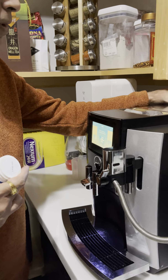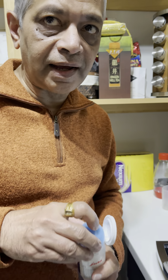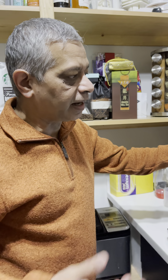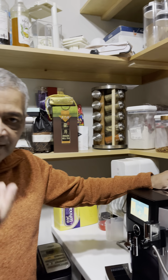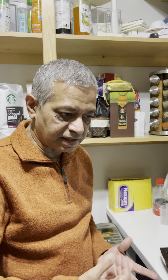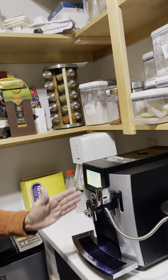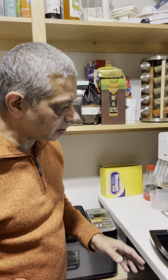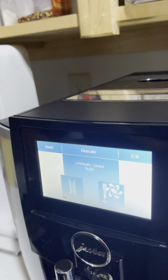At the proper time you will have to insert a tablet over here. The machine usually warns you when to do it, but I recommend doing it once a week. The reason being — coffee tends to be very greasy and oily, and that oil will stick onto the gear system on the inside. You don't want the gear system to get oily and sticky, so using these tablets will clean the coffee system and keep the gear system working properly. The other part is the milk cleaning system — this is the limescale product.